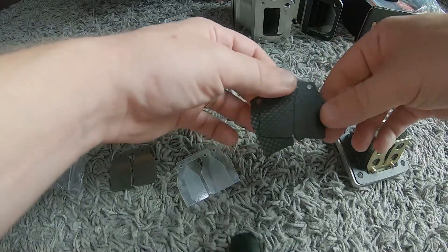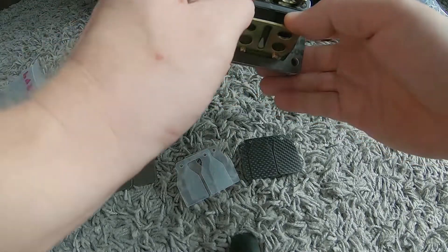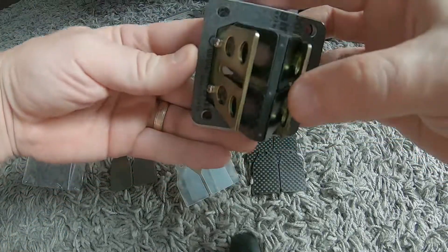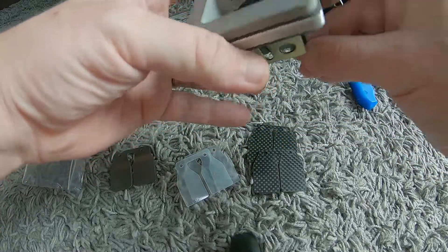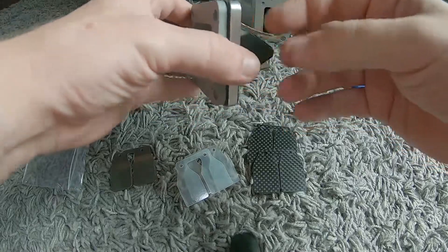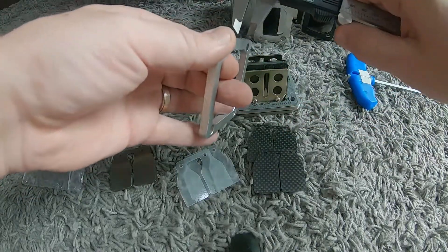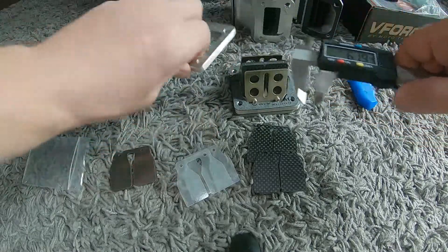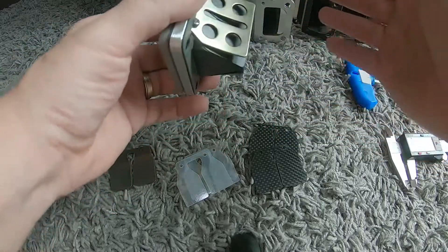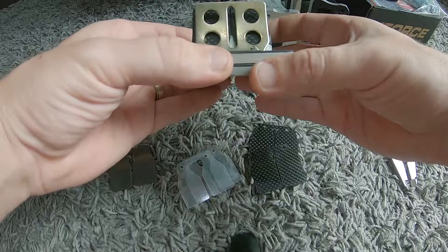So of course that's going to be a lot stronger and more durable. Being thicker, it's going to snap back a lot better and make a better seal. Now these ones were custom made by a local guy, although on close inspection it seems they don't seal up exactly. I have done a reverse pressure check, and when there's pressure pushing against them, they do seal up pretty nicely. I've also added to the stock reed cage — it's about 6 to 6.1 millimeters — and what this achieves is a longer intake distance, which can help with low-end power.